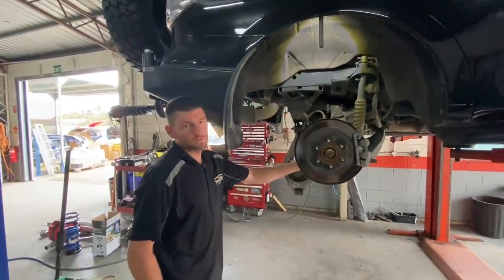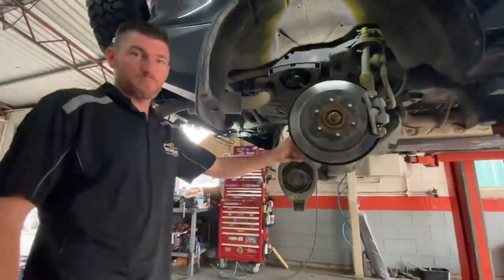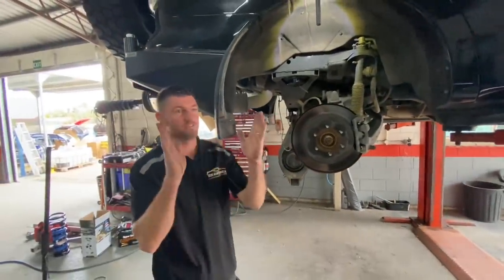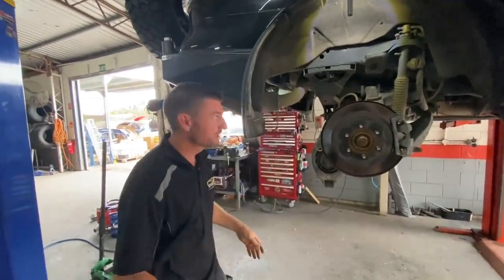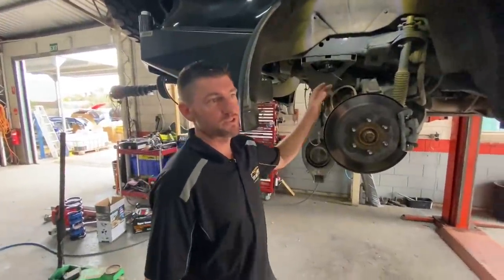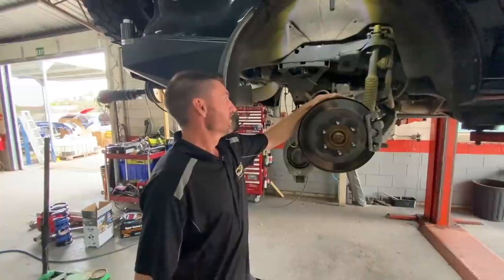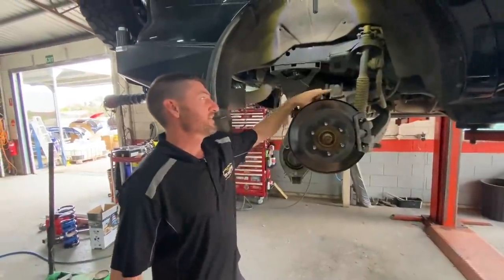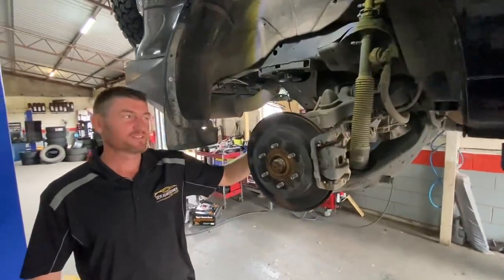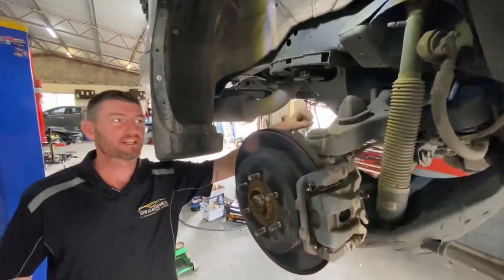Welcome to the back of the car. The rear is a little bit more involved - it looks like you'd just put a spring in and be done with it, but no. You'd be driving down the road with your wheels looking all wonky. We've got to deal with these camber and caster bushes, which are something I've spent a bit of time working out how to do. This dreaded ball joint sometimes gets jammed and people have different ideas on how to get it undone.